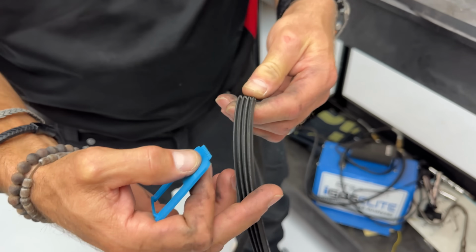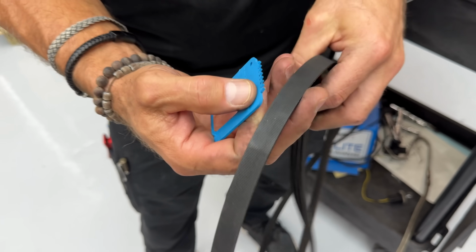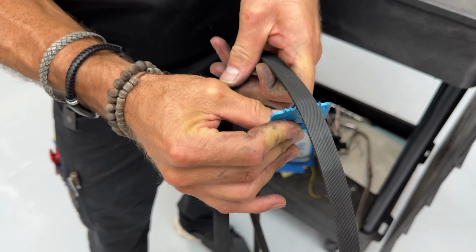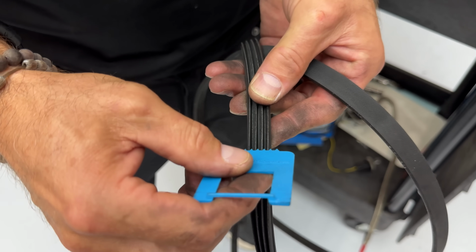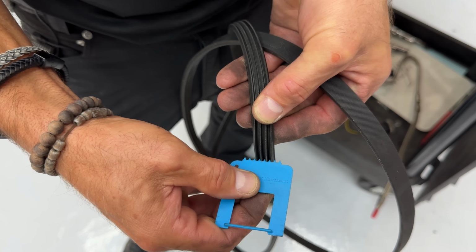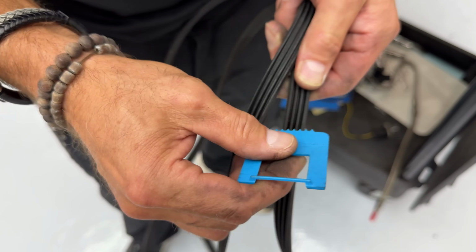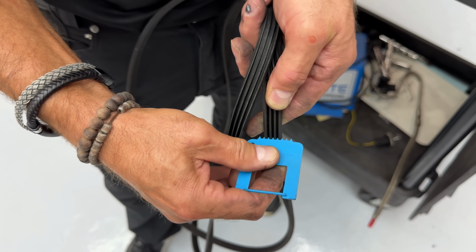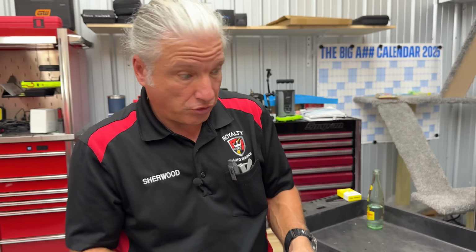This one has a couple ways of doing it. Again, let's put this in there. Let's put it in a good one first. Again, you can do this on the car. I'm going to show you upside down just because you'll get a good visual of it, but you can do this in the car also. We'll do it on this Jeep. Let's say I put it in this one, and you can see that's a massive amount of play, right? Okay, let's do this one. No play. That's the belt moving. That tool is not moving, right? That shows that the belt's bad.